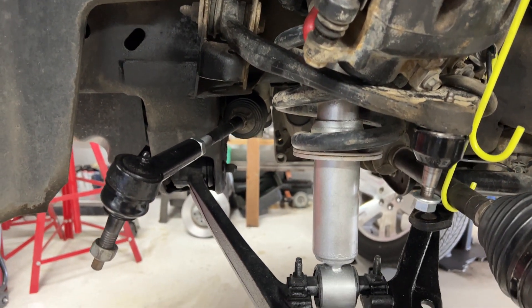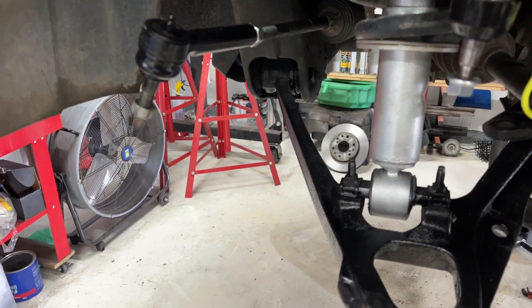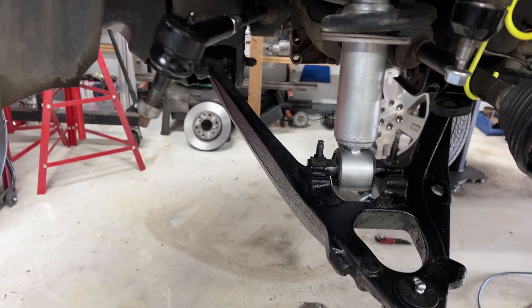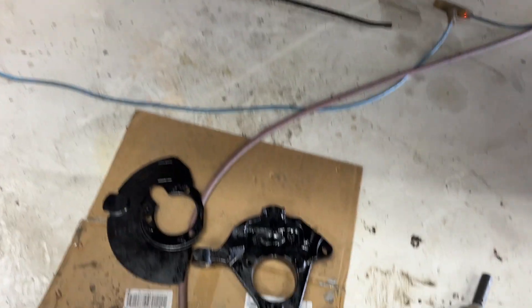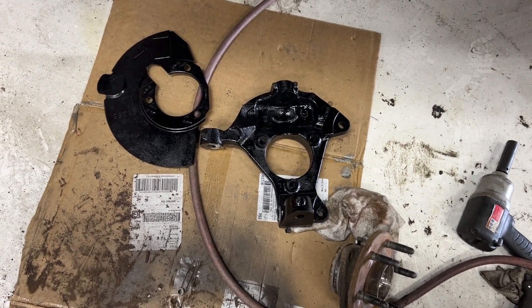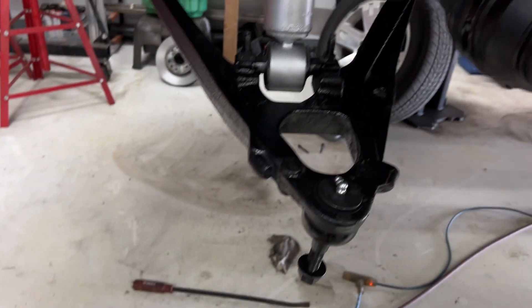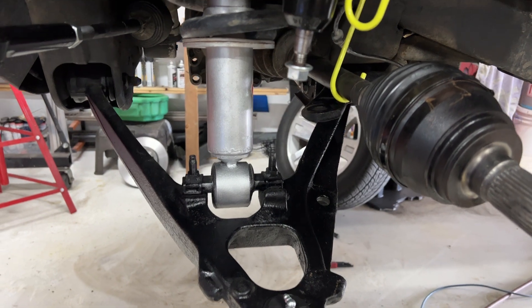These things always tended to be a little droopy in the nose, so that's going to push the front end up. Just painted the control arm after getting all the rust off of it and stuff like that. Minor stuff like took off the knuckle and powder coated it — that was getting a little silly, but hey, one of these things when you're already there.